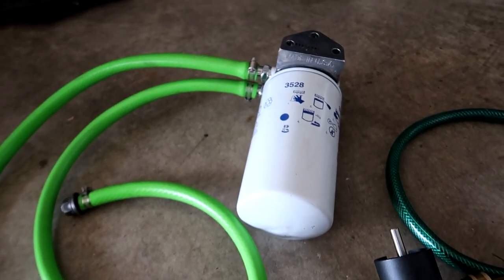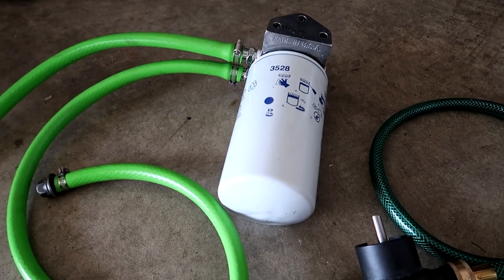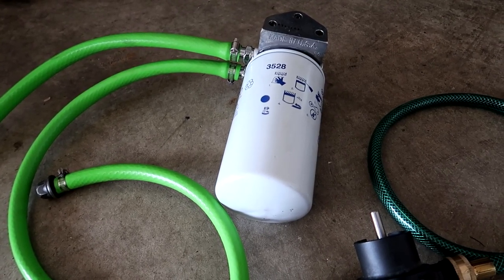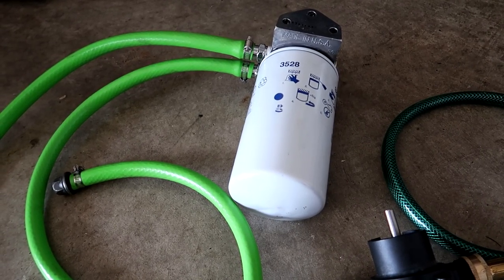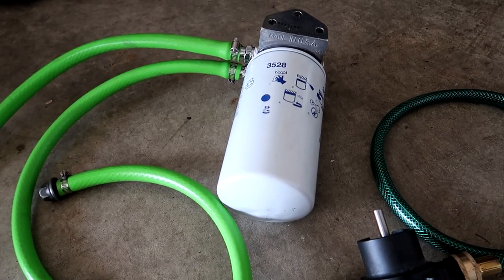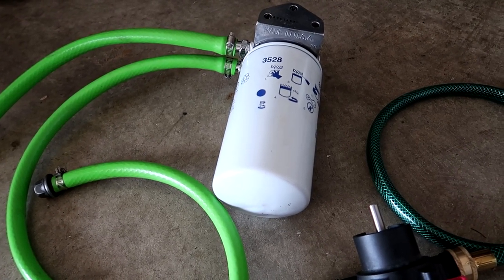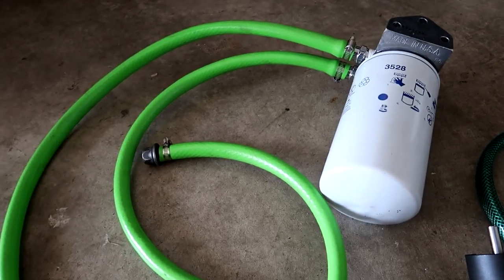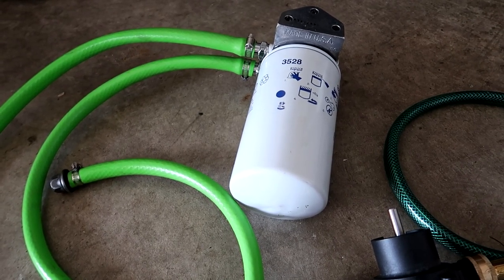Same as last time, this does not separate out water. But my used engine oil is pretty clean — I try to keep coolant and water out of it, so any minute bits of water won't harm the diesel at all. The vehicle has a fuel-water separator filter built in, so you just drain the water out of that every now and then if you have to. Most diesels do have a water separator on their fuel setup.